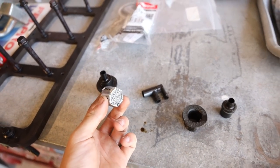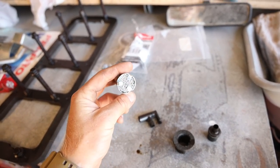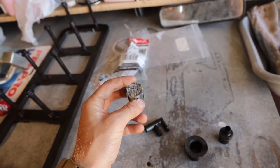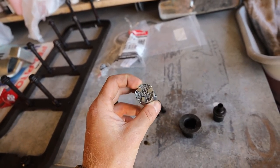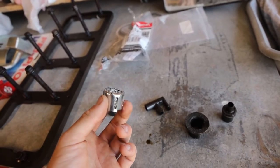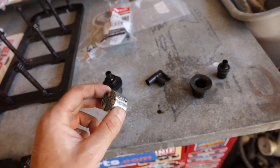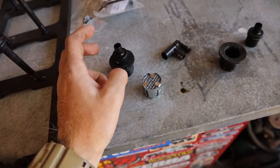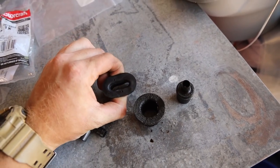Looking from the top of the car, you can see there's nothing in there — just the intake port, no screen, no nothing. It just goes straight into the intake gallery. What you should have is this little oil-air separator. Any oil-air separator is made with a metal web mesh that prevents oil from going past it. It's made of wound-up metal instead of fabric so it doesn't get saturated by oil over time. These things get clogged with oil and carbon buildup — so if your intake is down on power, sounds weird, or is burning oil on decel for any reason, this guy could be melted, blown out, or missing entirely.